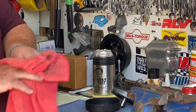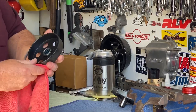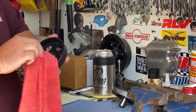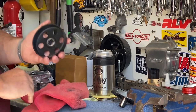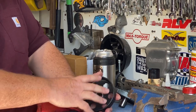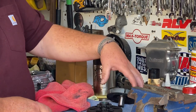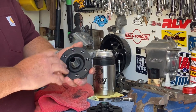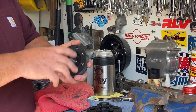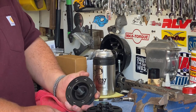I'm going to wipe off my hands, and then wipe off any grease that's on the inside of this clutch. If your clutch is old and dirty, use some WD-40 inside this drum — you can wipe it down with WD-40. Same thing with the shoes; you can wipe the shoes down with WD-40. The WD-40 is going to burn off once the clutch starts working, so it's not going to hurt anything.